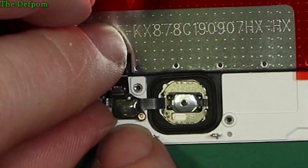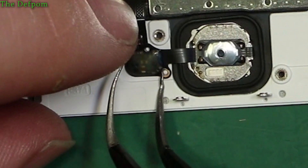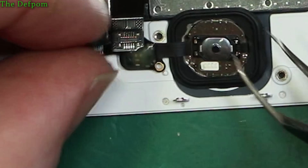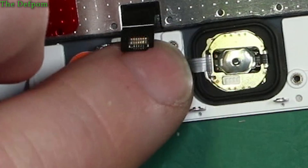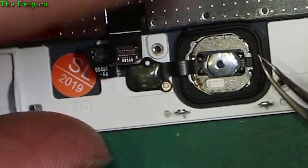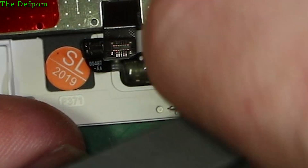Just get the circuit board located first - it's got a little locating pin which goes through this hole, with the flex just there. There are two of those, so get those lined up. I moved the flex but there we go - that's both of those located. Give it a push down with your finger nice and gently, being careful not to catch on anything. This one actually has the assembly with the flex already in there - they don't always have that. The button should be in alignment now - gently push that in.